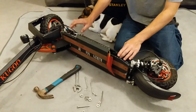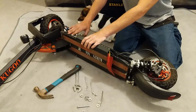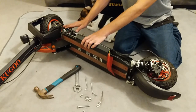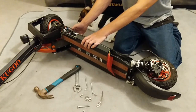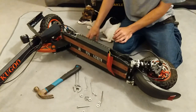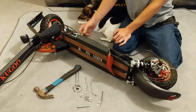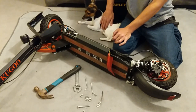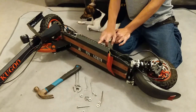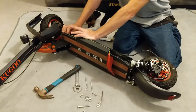The first thing I'm going to do is disconnect the three bullet connectors for the motor. You've got to take your front casing off as well — it's just two bolts there and there, it pops to the side. Be careful with the RGB wires, they're really thin and will rip away. They're not a nightmare to solder back on, but you don't want to go down that road.